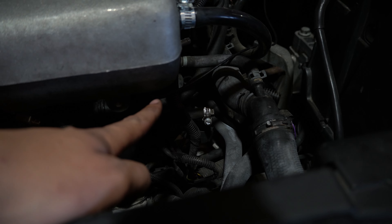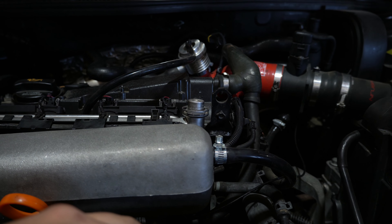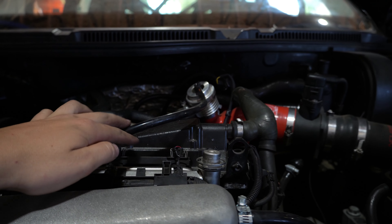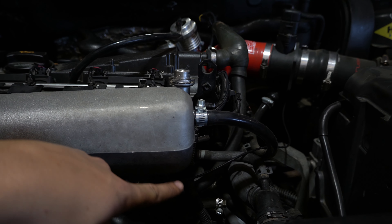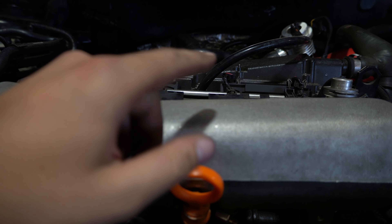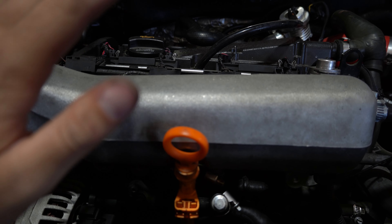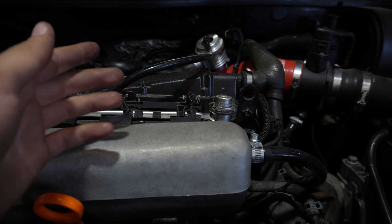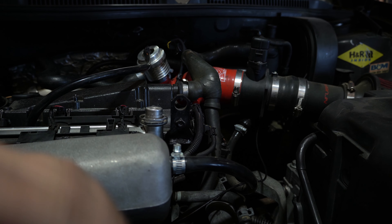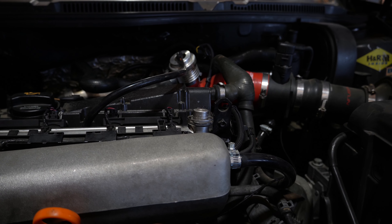So I was taking a look at the motor and I noticed that the diverter valve hose was hooked up to the smallest port on the intake manifold. I was like, what the heck — that does not seem right — and I'm the one that did this. This build has really helped me realize it is important to have properly sized vacuum hose for what you're doing. The diverter valve was hooked up to the smallest port, and now I have the boost gauge running to that. But there's another port over here that was exactly the size of that hose, so I took it and put it on the line coming off the intake manifold right there.